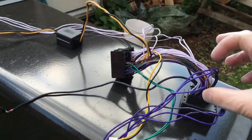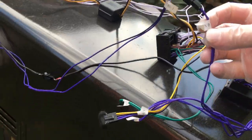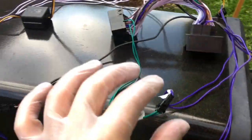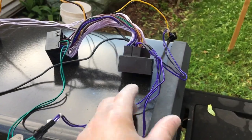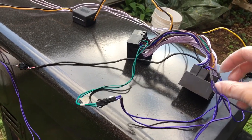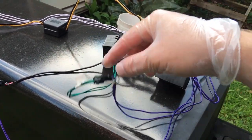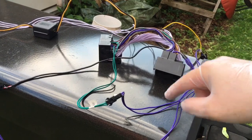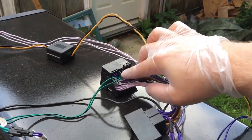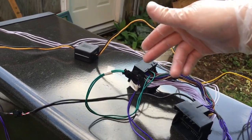Sorry about the camera — CAN high splits out into three wires, and CAN low also splits out into three wires. I still hadn't quite made sense of these yet, so I disconnected and reconnected them just to untangle them and it makes a lot more sense now. CAN high and low come out from the car side and one pair of high and low plugs in here and goes into the exact same pin on the iDrive side — so that's just one-to-one, car to CIC or your stereo.